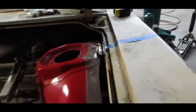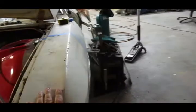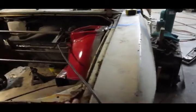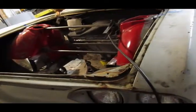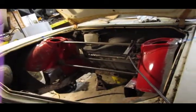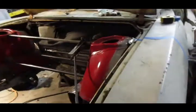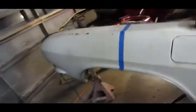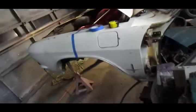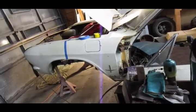While I'm mentioning it, I sort of tacked these shock towers to the fender, and you might think that's stupid. But the fenders on these cars are all integrated — they're all welded together. You cannot remove these fenders; the front end and fenders are all one piece, all welded together. That's unusual. Cars back in the day were not normally made like that, although the Volkswagen Karmann Ghia was done the same way — the front end is all welded together. So you can see the fender is just part of the body.